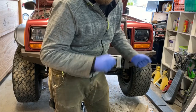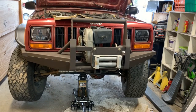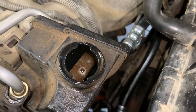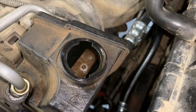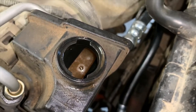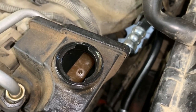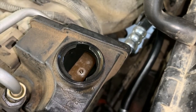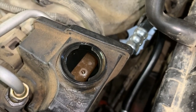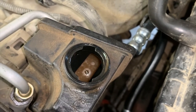Start it up, turn the steering almost to lock but not quite, back and forth a number of times, then check the level and see where things are at. You might find your steering fluid looks like this — that's aerated, meaning it's full of tiny bubbles. Those bubbles are what we're trying to bleed out of the system.